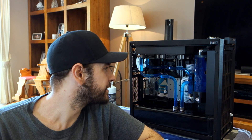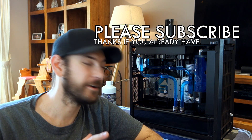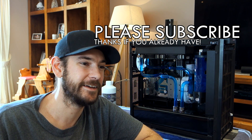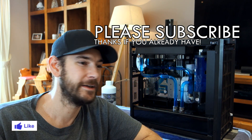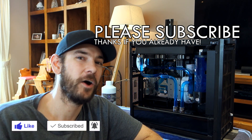We've had it sitting for a couple of hours now and everything looks totally fine - there are no leaks at all. The bubbles have pretty much all come out of the system, there are no bubbles left in either of the heat sinks that I can see. So we're going to put the sides back on, plug it all back in, and run it up. We'll let it sit in the BIOS to make sure the CPU and GPU temperatures are okay, then boot back into Windows. The next step after that is going to be overclocking, covering all the settings and what they do. If you're finding these videos interesting, please hit the like and subscribe buttons, and I'll see you in the next video!